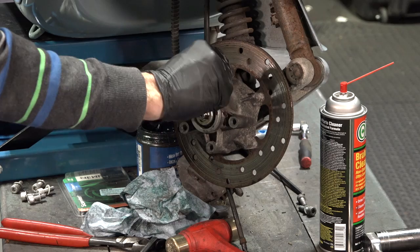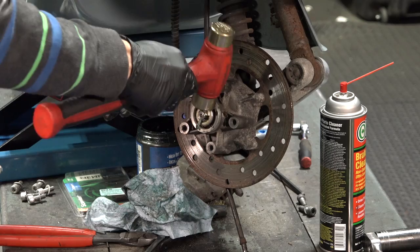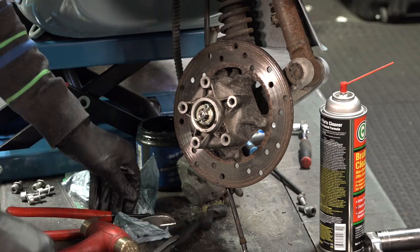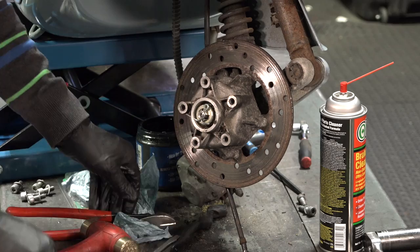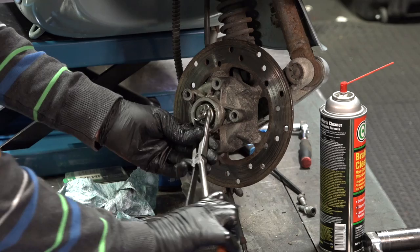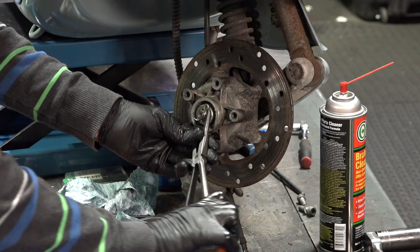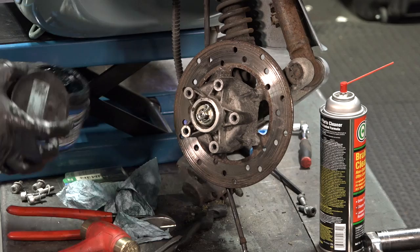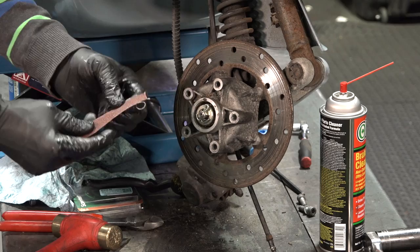It's a slightly shorter version of this cotter pin. Sometimes you want to use your hammer. You'll see the two ears popping out right there. You're going to have some friction with that heavier grease along with the speedometer drive — obviously as the grease heats up it's going to free up, so nothing to worry about. Definitely shouldn't be crunchy or grinding. It's pretty critical to get these tabs all the way in because they'll get in the way of the wheel. We'll put our grease away. We're done with the grease for the front. We'll get some sandpaper and go ahead and scuff that rotor up, then pop new disc brake pads in there.